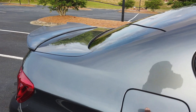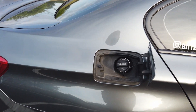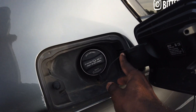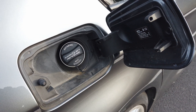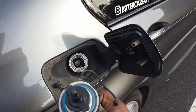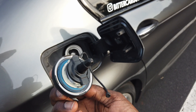The process to replace the existing gas cap is pretty simple. Just open the fuel filler door. On the door you'll see a little extension that holds the gas cap to the door — push it forward toward the car and that should snap out. Then turn the gas cap counterclockwise, take it out of the car, and you should have it in your hands.